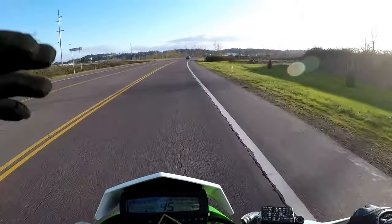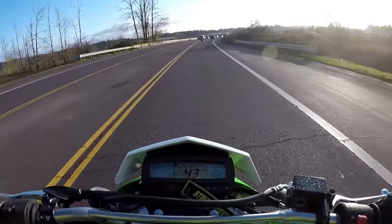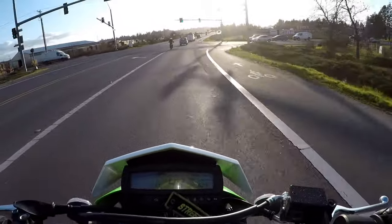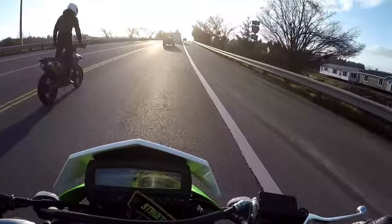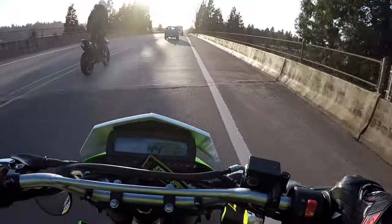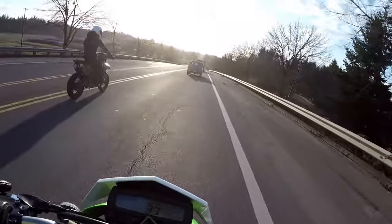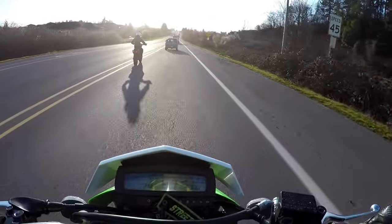So like I was saying, the Supermoto is definitely set up very well for the road. I was surprised — the suspension was actually pretty dang good for a stock bike. I think Kawasaki pretty much nailed it for what people are probably going to use it for: on the track, twisties, city shenanigans. If you're going to be hitting jumps on the street, it's going to soak them up real well because the compression damping is definitely stiffer than the Dual Sport — but the Dual Sport needs to be softer for trails, which is easier on the rider off-road.